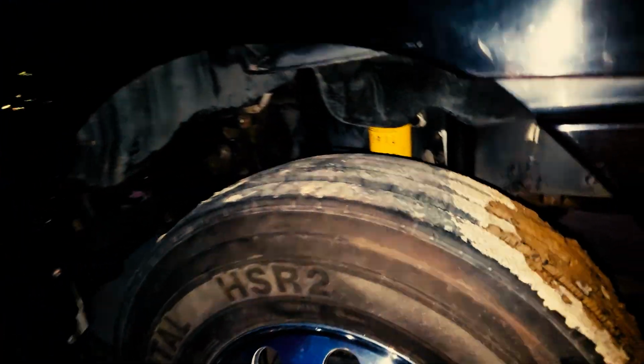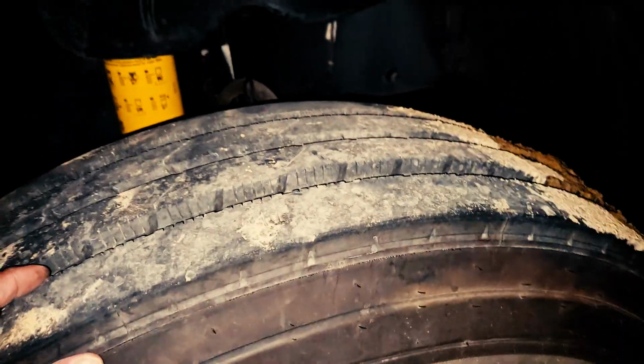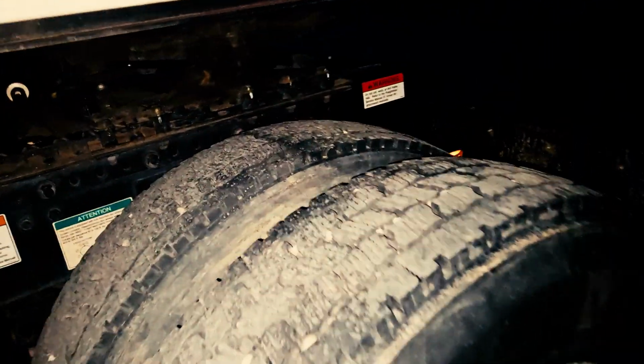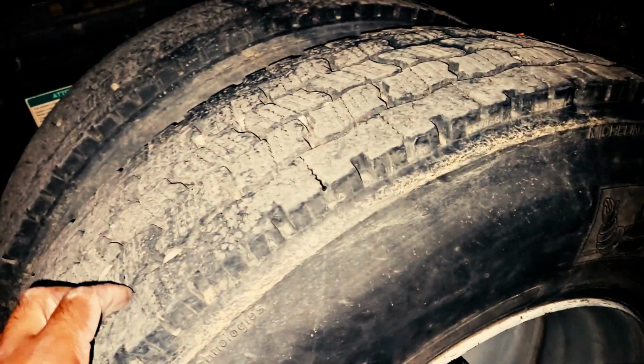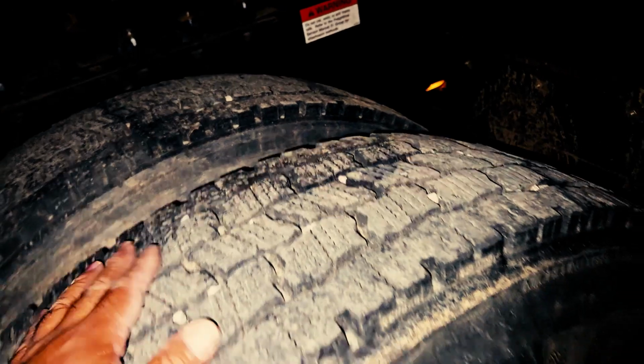So in all cases, you need to know how to inspect all the wheels, because any examiner can decide not to have you inspect your steers. He could have you inspect your drives. Now, obviously, all the general inspection for your drive wheels is the same as the steers: inner, outer, sidewalls, except that you've got dual tires, so you have double.